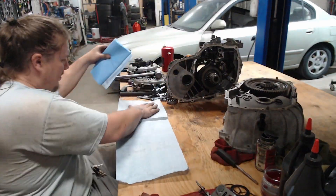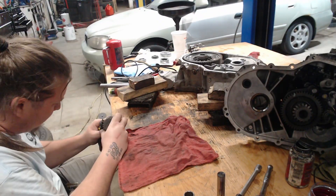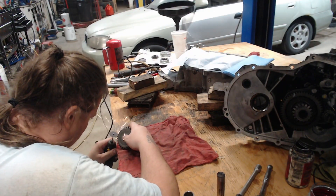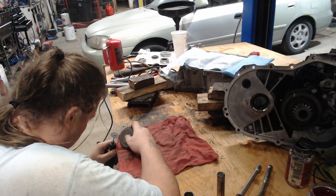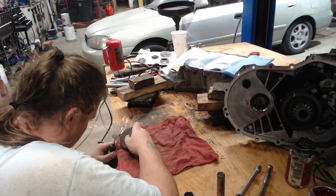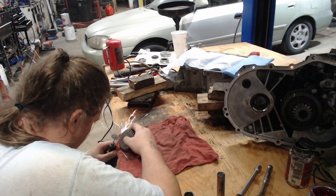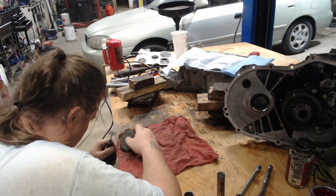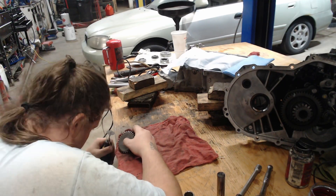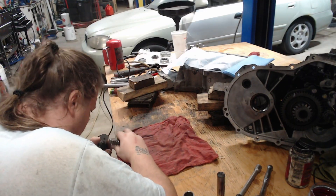After removing the bearings we clean the bench so we can remove the gear set and shifter assembly. In the full length video I did a bunch of inspection and cleaning that isn't shown here. This is the very sped-up footage of reshaping the tooth facing on the reverse idler. I didn't get a chance to do it on the synchro sleeve, but the reverse does engage far nicer than it used to — it used to crunch in every time and now does not.